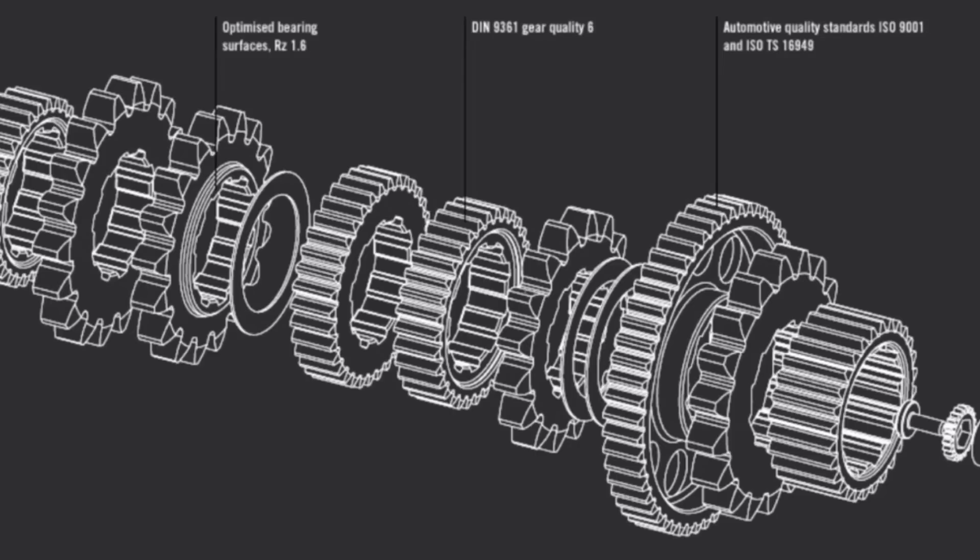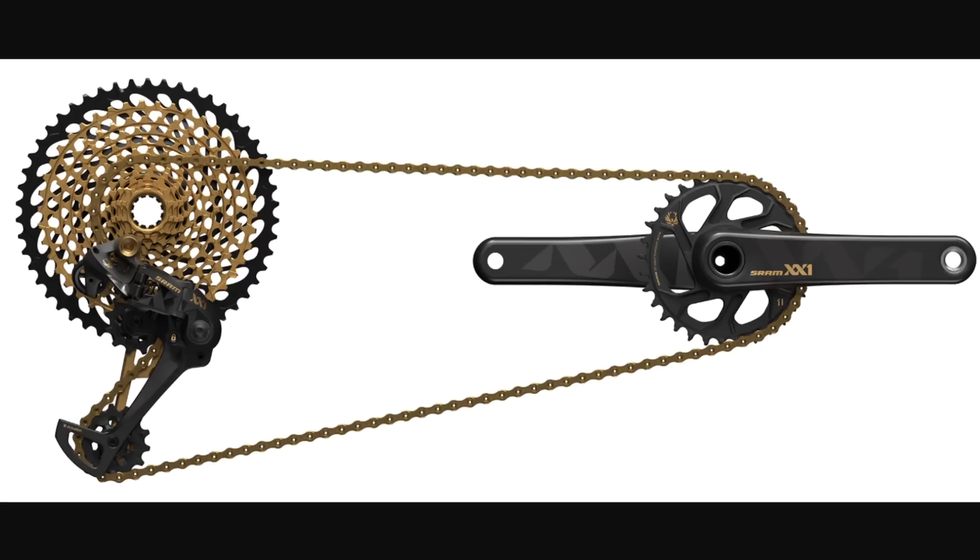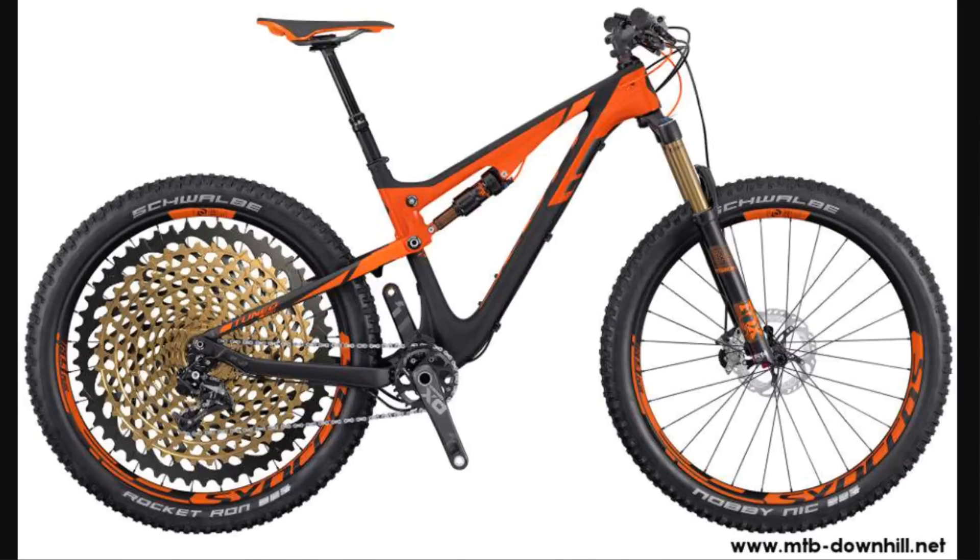It's one of those things you have to get used to, but I was just so surprised how good the suspension actually works with just that little bit of less unsprung weight. Also it has a super wide gear range — 600% — and they even make an 18-speed gearbox which has around 800-something percent. SRAM Eagle is like 500%, and that's kind of how much a 2x10 used to have in the past. So you get a range so large that you don't really need the easiest gear or the hardest gear. You basically have a gear for whatever you get yourself into.